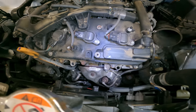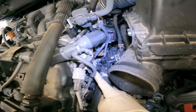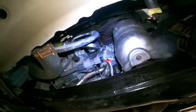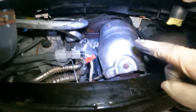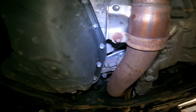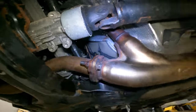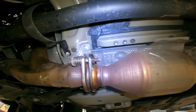Now that we have the heat shield installed, our connection has been made. We know our crank sensor is plugged in down there. We took it back up top — the O2 sensor is connected, exhaust is installed, we've got new hardware and new gaskets installed. We reused the ones that were still good, new hardware up top, new gasket here, new gasket here, and a brand new donut gasket in between. Meow.